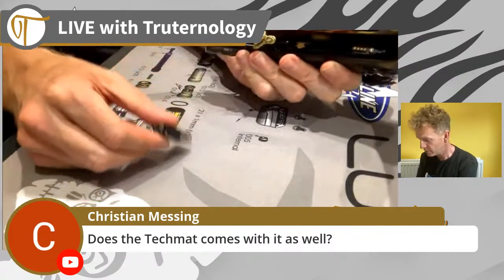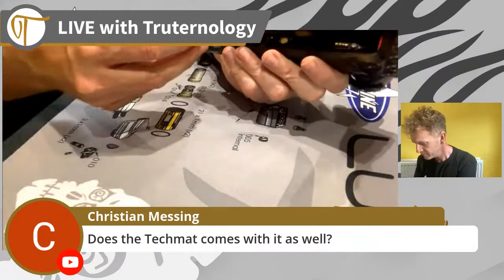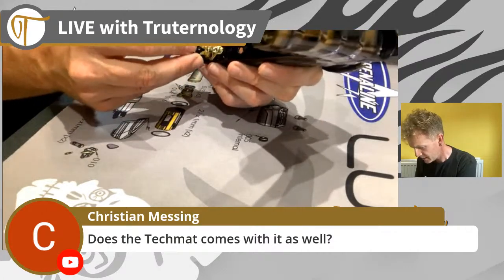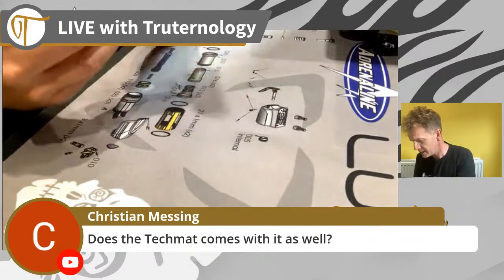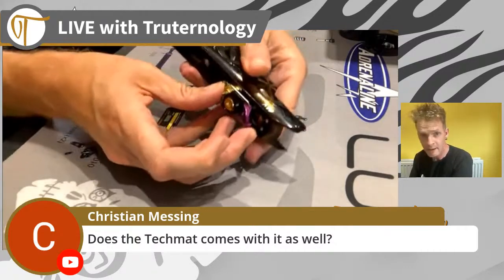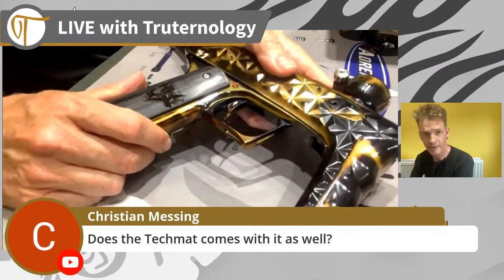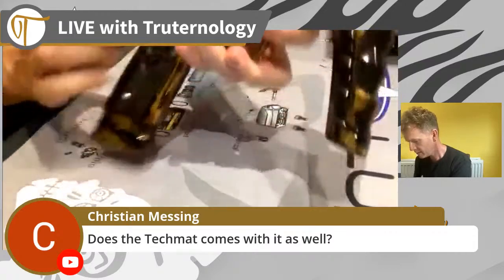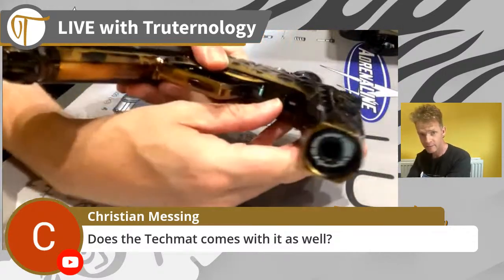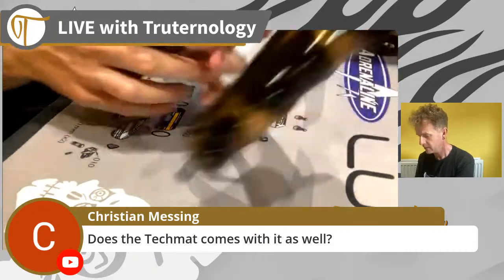Release the solenoid clamp, pull the solenoid out - the electro solenoid out. You can tell it's the electro one because it's bigger and it's also got the little circuit board at the bottom. Locate the mechanical valve, insert it in here - it only goes one way because it has to latch in. Close the latch, grab your mechanical frame, line things up, push together, pull the rear latch down and lock into place, then slide the front latch forward to lock it. Bolt assembly back in and you are good to go.